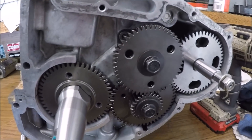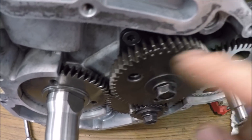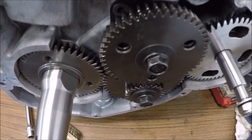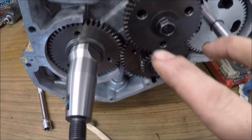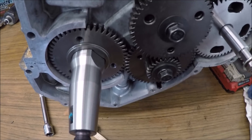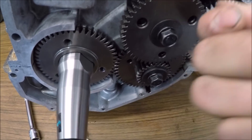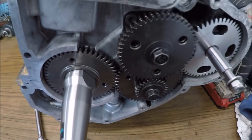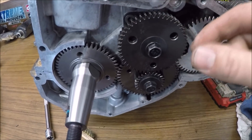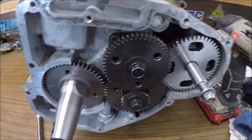The way to line up these two gears — there's a spring in there that needs the piece counterclockwise a little bit. I took two flat blade screwdrivers, put them in there, and as you push them in and turn them it'll line up. With one of them I pried and torqued a little bit to where they lined up and then pushed the rest of the way. There's supposed to be a little dowel tool for this, but the screwdrivers work beautifully.